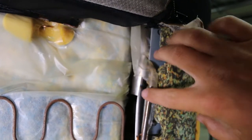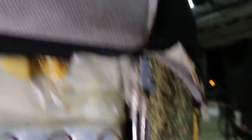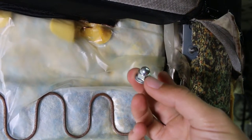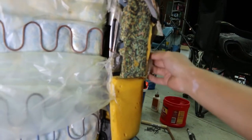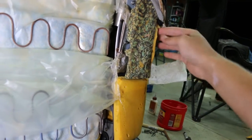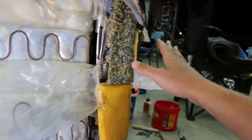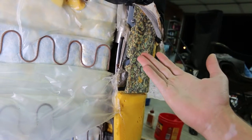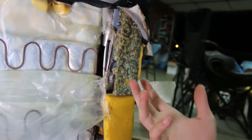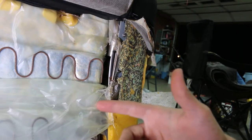So I'm to the part where it's talking about removing the airbag. They're held in by these two bolts - one there, one there - and there's a 10-millimeter nut that holds those in. It's hard to get up to it. This is held by some tape. I had to peel that back and this is actually torn just a little bit. It's not bad - I stopped before it got bad. I don't really know that I have to take out the airbag, but that's what this person did.